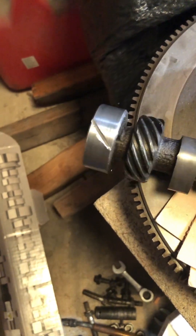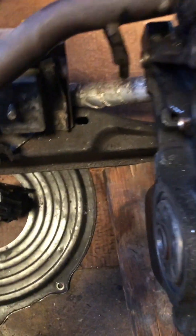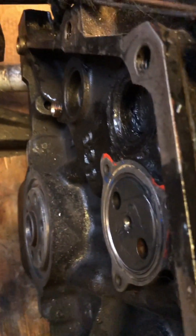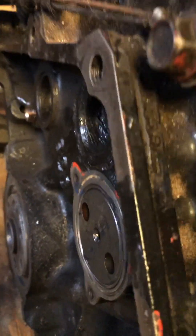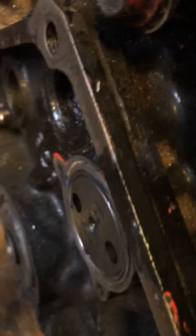To get the good clearance I ended up doing the old school method of grinding notches at 45 degrees and using those notches to scrape the bearing. That method works great — this cam spins nice and free, no binding whatsoever. The reason it's not free-rolling right now is because of the assembly lube I put in it. But the cam went in beautifully.